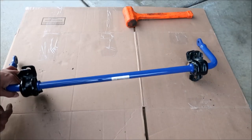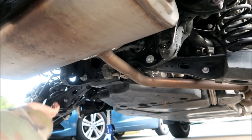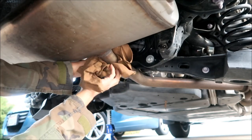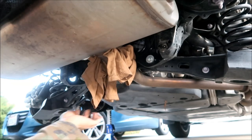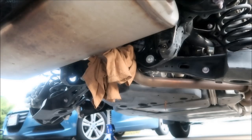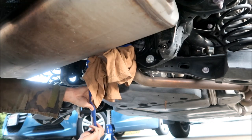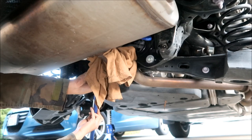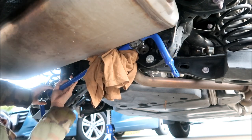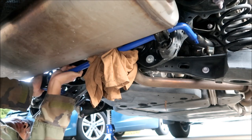The K arrow should be pointing up — that's how I know it's the right way. Let's install this. I routed the sway bar from the left, so that's the way we're going in. I'm going to put a rag over the exhaust so we don't scratch our beautiful new Cusco sway bar. You can take one of the bottom sandwich pieces off if it falls. I can slide it on the exhaust pipe — it holds it up for me. I actually recommend leaving the muffler in there so it holds it up.